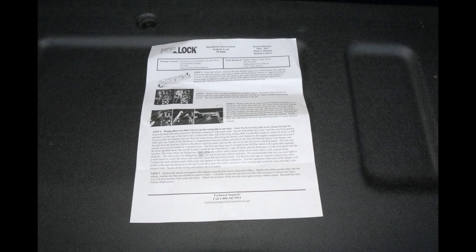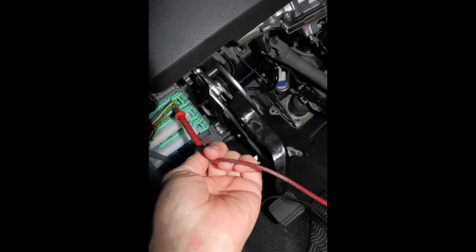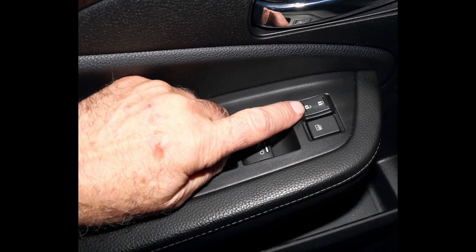The eTrailer instructions for wiring were accurate for my Ridgeline, but verifying wires is a good idea. Ground one lead and tap into the appropriate wire on the wiring bus with the other. While holding this, press the lock button to lock and unlock. You should see the voltage spike to 12-ish volts in one of the two positions. The same for the second wire. The two wiring harness wires swap positive and negative roles to give the PopLock forward and reverse action.